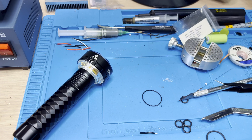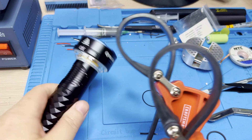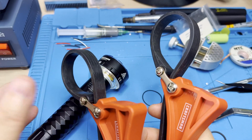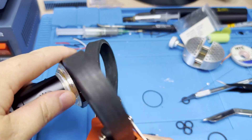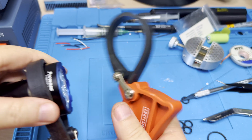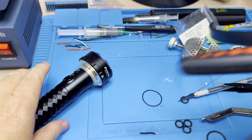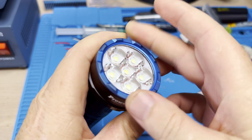Welcome to the madness of my shop — don't judge me. The first thing you've got to do when you want to swap this light is use strap wrenches. I like these Craftsman strap wrenches — they came in a pack of thick and thin, but I bought two packs and use the thin ones only. I put one strap wrench around the head around the black part, and then another one the other way at the blue bezel, and I crank it. Now I've done that off camera for time, but you can see this thing moves freely now.